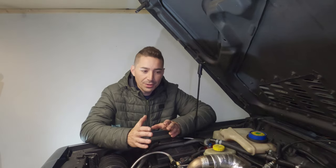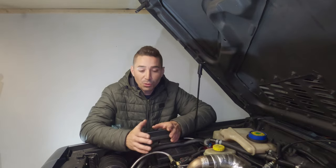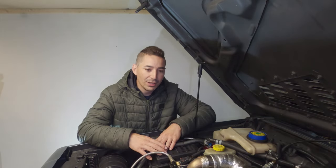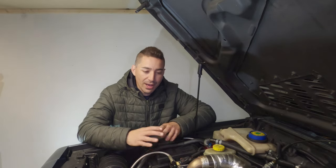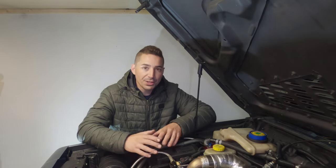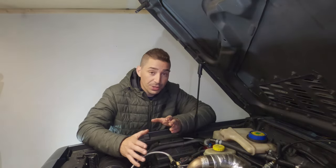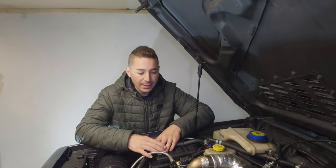That is really the main way of making a lot more power out of the engine. More fuel basically means more power, and then you balance that out with more boost, and you get that mixture right, and everything's going to work for you. But I haven't done that with regards to the mods I've done. Everything I've shown you is capitalizing on power that the engine is already capable of, that the infrastructure already supports. It's power that's already there, basically.